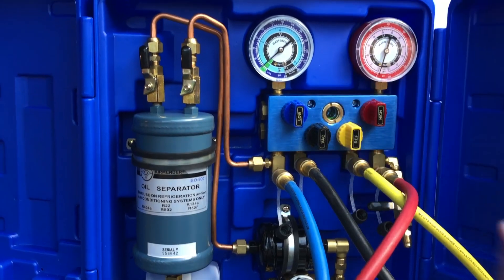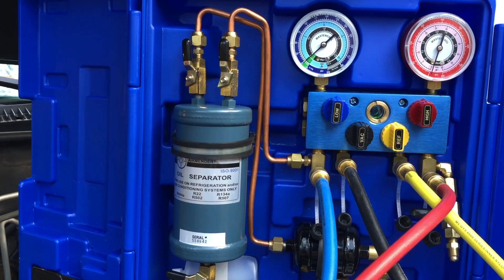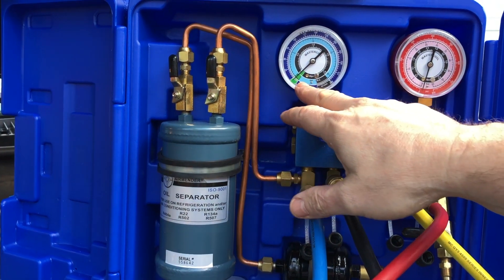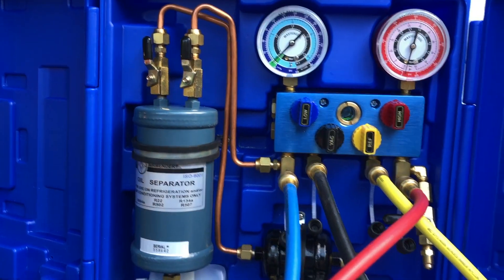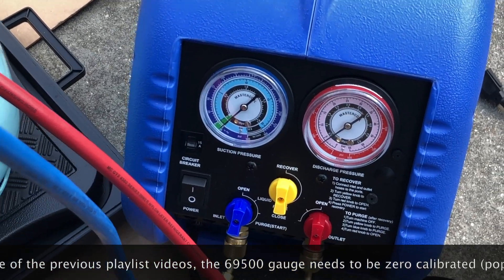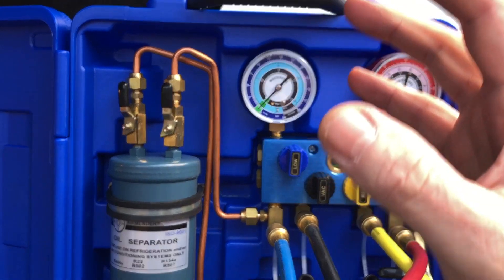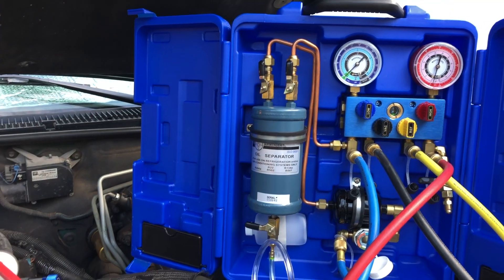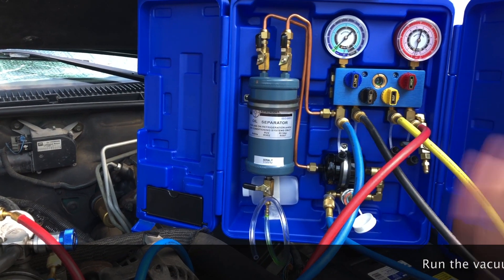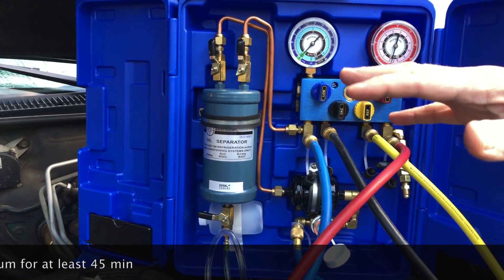We can turn the vacuum pump on, open this valve, and come over here and open this valve — you can hear the vacuum pump doing its thing. Previously we were vacuuming out our equipment, but now we're actually vacuuming out the whole vehicle. The recovery machine can only go down to so many microns — now we have to take it the rest of the way with a vacuum pump, which is standard procedure and EPA approved. Both valves on our recovery cylinder are closed; we're simply pulling all of the residual material we could not recover. I'll let this go until we pull it all the way down and then come back to wrap up.